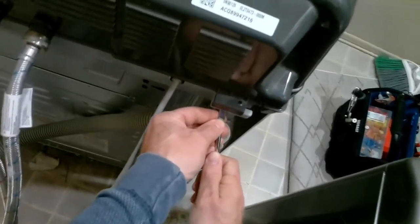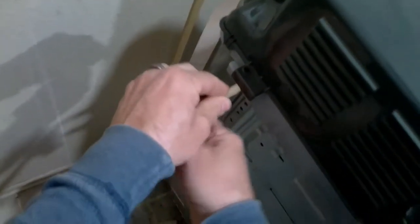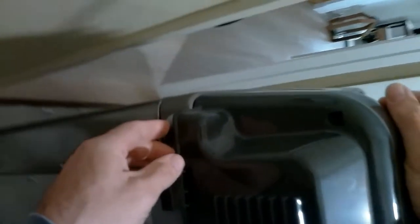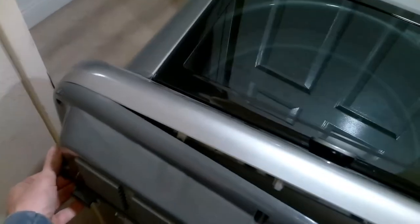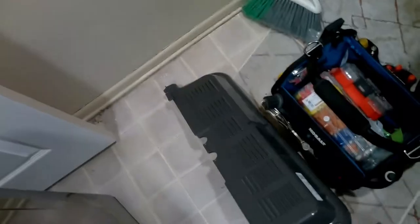So now you're going to take a flathead and come up under the lever or the latch here — it's probably facing outwards — and it should just pop right out. There's one, here's two. Just basically take your time and be gentle with it. Never force it too much because you could crack it. As you can see, it should definitely give eventually. As you can see, we have clips — it just basically clips in. So you have to pry it out, but gently, and put that out of the way.